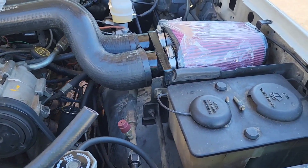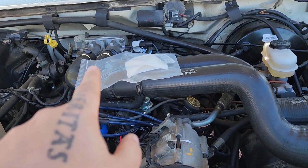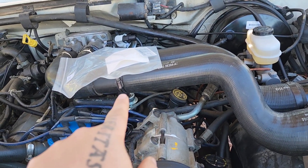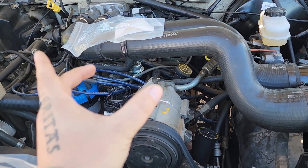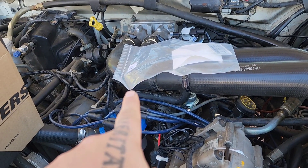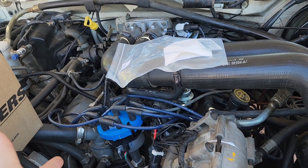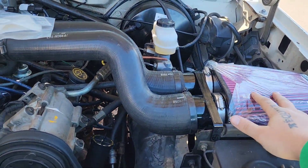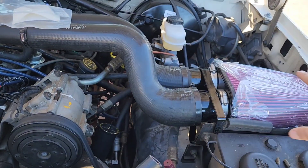In the future what I'm gonna do is mount that up to that, and then just do a regular small vent there. For this idle air I'll put a smaller, like 3-inch air vent or air intake. That way I'll have direct intake right there — air will come here and get the warm air off the engine and feed it, instead of having it go through all of this hose. That'll also open up a whole bunch of space over the wheel well for other stuff.